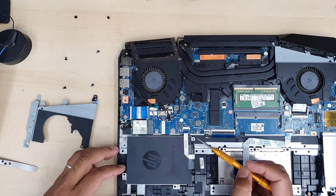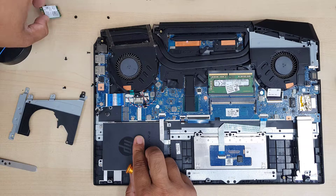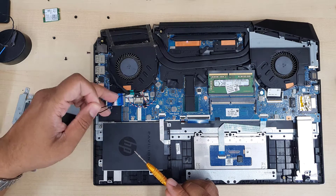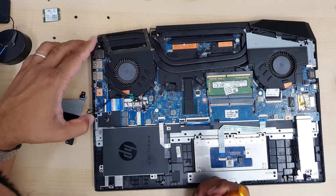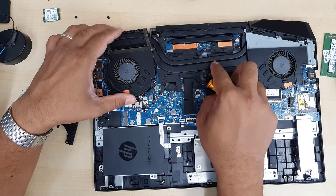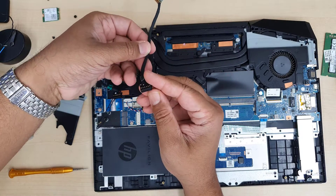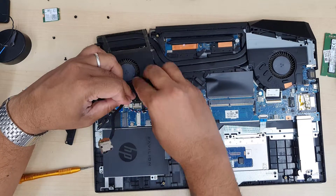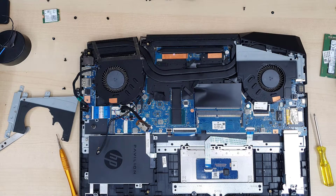Because this is a long process, what we're going to do first is disconnect the broken charging port flex connector and reconnect the new one just to see if there is any indication of light — otherwise there is no point going further. If you take out the heat sink to remove the cable, you have to reapply thermal paste and deal with a lot of screws and the secondary board. So it's always good to give it a try first.